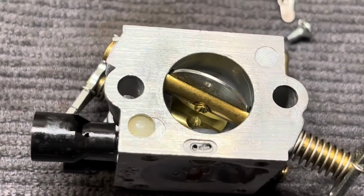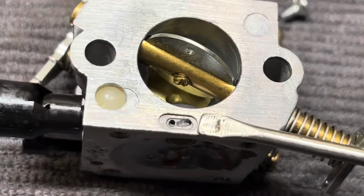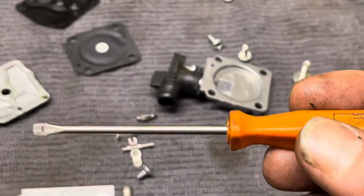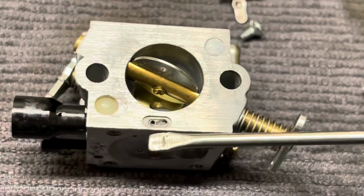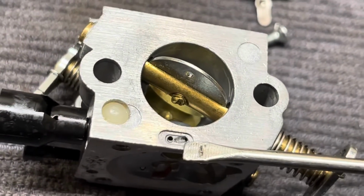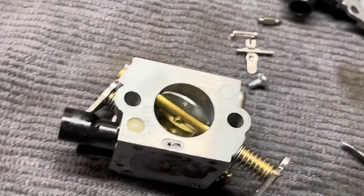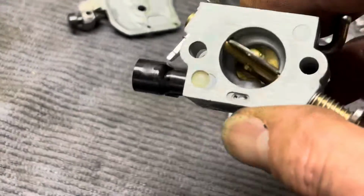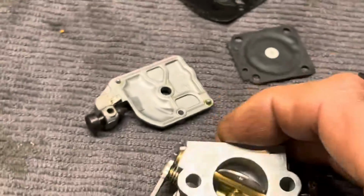All right, just wanted to show you, I pried the foil off of there. And just to show you how tiny those holes are, see, I'm all zoomed in on it right there. This is like one of those steel tuning screwdrivers. So when a little booger gets into that little tiny passage right there, you're obviously going to have a low side circuit issue. I mean, supposedly it's there to improve the throttle response. I don't notice any difference at all with it blocked off.